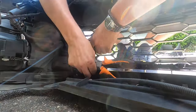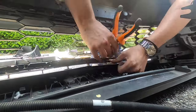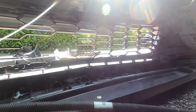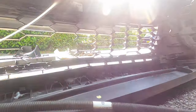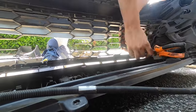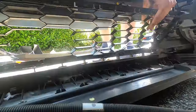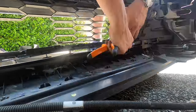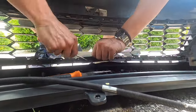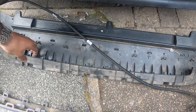It is really frustrating and annoying, but you just have to go really slow and steady because you do not want to break these clips. The best way to go about it is: once you've worked the screwdriver in to give it a bit of room, pull the grill out and away so it won't re-clip back in on its own. Once you get one clip out, move on to the next and rinse and repeat. I also realized the bottom section was really tight — but that inside dust guard can be removed, which gives you access to all the other clips. Definitely do that first, unlike me who left it till last.